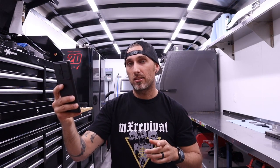It has a massive hit down low, and it flows more than our current 38H series for better top end as well. Now, in my case, I have a little bit more tweaking and tuning. Mine was a little bit lean on the power jet, which is basically 50% to 100% throttle. So I need to open that screw just a hair and get a little more fuel in there when the bike's wide open. I was hitting sort of a ceiling, if you will. The bike was just a little bit lean. So I know I can squeeze a little bit more over rev out of the top end there, say ripping up a hill or whatever. So I'm gonna focus on that next in some of the next rides.